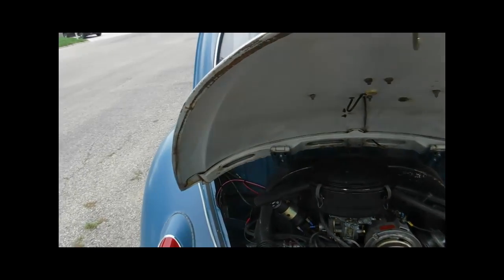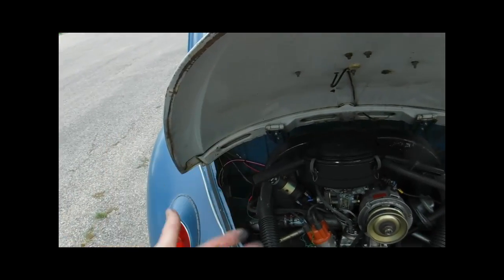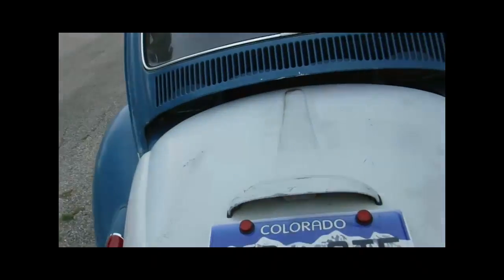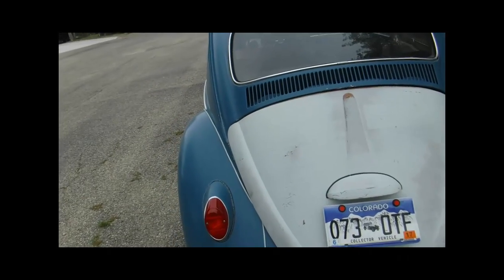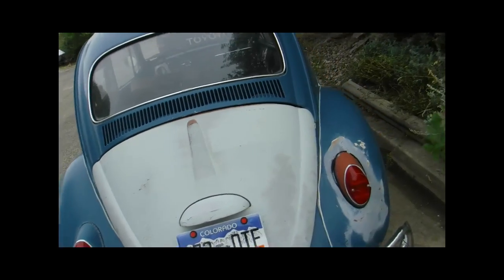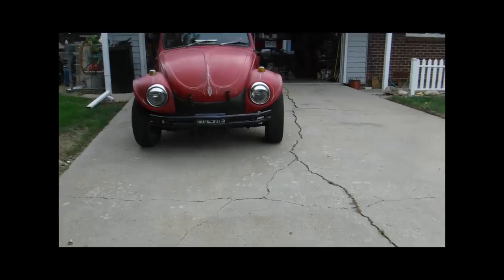Save you some trouble. If you're pulling the engine, you'll have to take those carbs off to drop it down and slide it out. Don't want to leave those carbs on. You'll end up at some point in the procedure having to take them off, and you'll probably have torn up air cleaners and linkage and everything else. That stuff isn't cheap, so be careful how you do that.